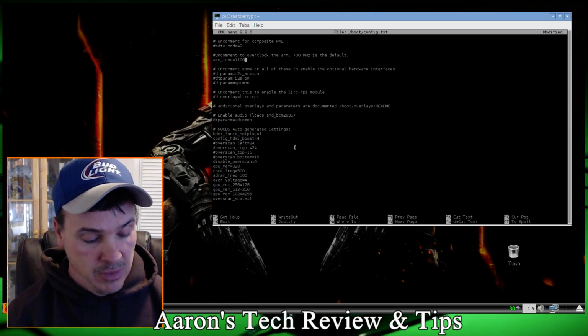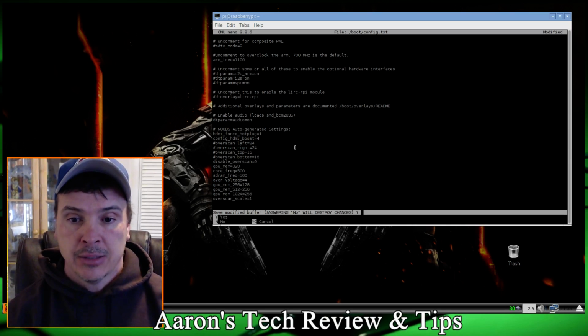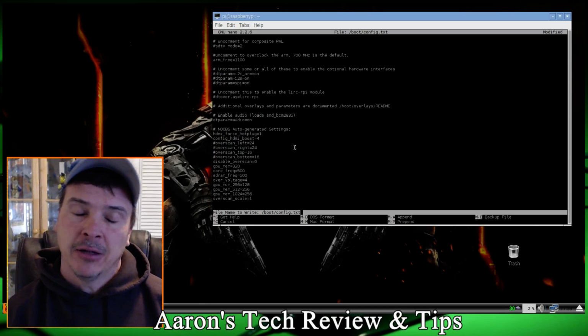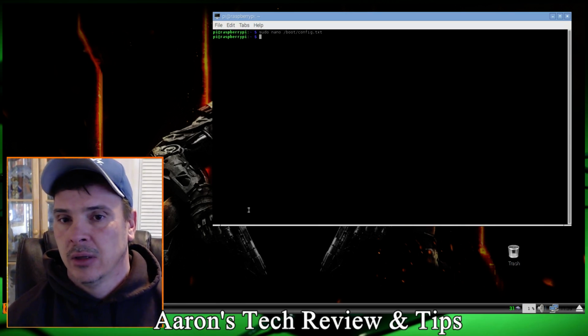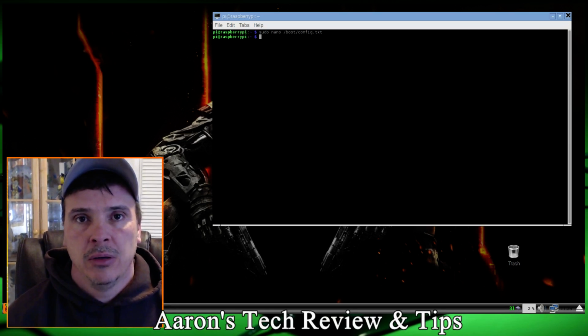Now, I'm going to go Control X. Okay. It's going to ask me if I want to save it. I'm going to say yes. And then it's going to ask me for the file name to write to. Now, you have to do this and just go enter. Okay. There you go. Now, you would reboot, and your system would then allow you to have an overclocked system.